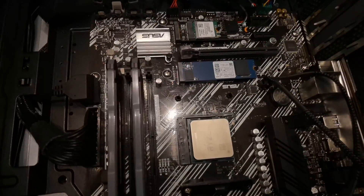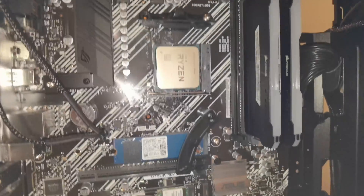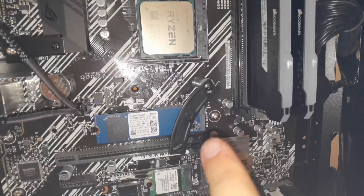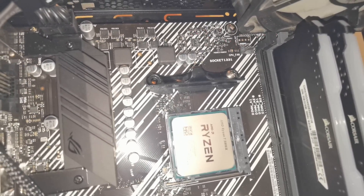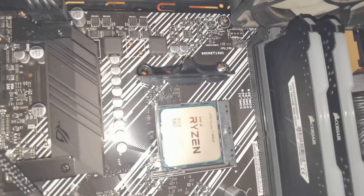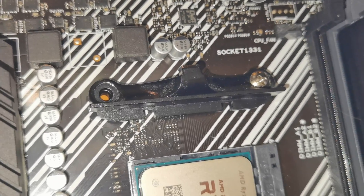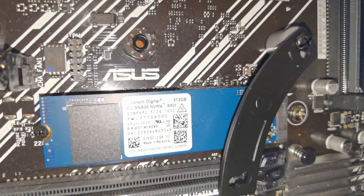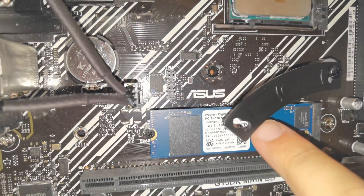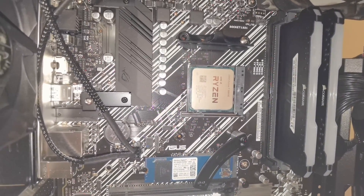So I'm gonna be back with the back plate. What I did is I put this one already in, so when I unscrew this one, the bracket - the back plate won't just fall off, which is a big inconvenience. I'm gonna remove that screw right there, and I'll remove it. I'll remove that one and then do the same process - just lever it back, install it, flip the case again, and be able to screw it properly and install the cooler.